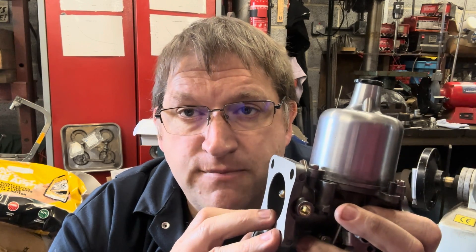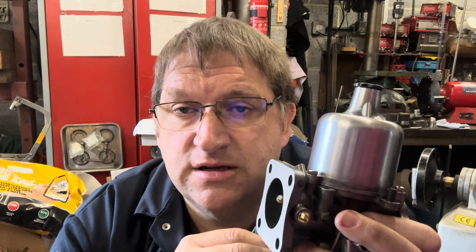In a road application, a car's got to go many thousands of miles. To reduce bore wear and get the economy where we need it, we need to reduce the fuel going through that engine. Lambda 1 means a perfect air-to-fuel ratio. If you go richer than Lambda 1, you have excess fuel, and that excess fuel is what adds to engine wear. So anything below Lambda 1 — say Lambda 0.95 — there's a little bit of extra fuel that adds wear, very small. But as it gets richer, so 0.9 or 0.85, the wear increases massively. When you're at 0.85 the wear goes up a lot, and if you go down to 0.8 then it's way up on the graph and very quick wear. You need to maximise the life of your engine to get the maximum bang for buck out of it, so your carburetor fueling needs to be perfect and under control.